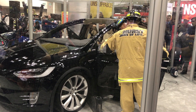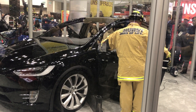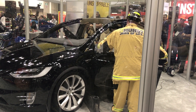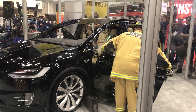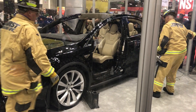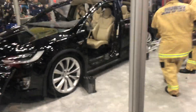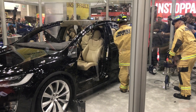We have typical latching and hinges on the front door of the Model X. Most of the Tesla Model X is constructed out of aluminum — but this isn't soda can aluminum. This is high strength, very brittle, very strong aluminum, which is different from the steel construction we typically see in conventional vehicles. The behavior of aluminum is that it breaks under pressure, unlike steel where it may flex and bend.